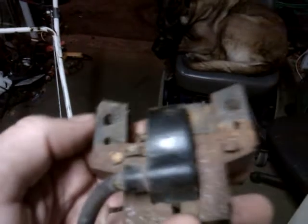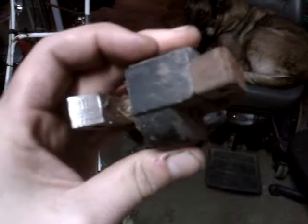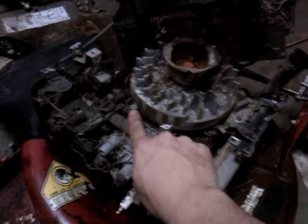In the last video I said make sure these are shiny, and obviously they are — I cleaned the area where it would go against the flywheel. The easiest way to do this, and I'm not kidding, it works perfectly: my trusty old Dremel 300, variable speed with a sanding drum. Put that down there and hit all those surfaces with that, including the podiums here.